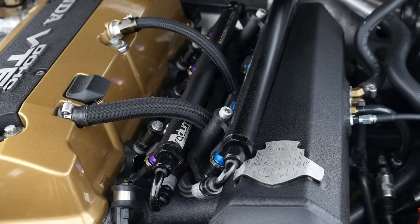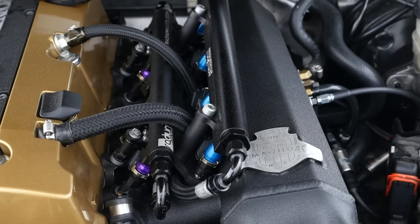It's using Ignite Red, which is like an E90 blend with probably some race gas. The fuel pump is the Veyron fuel pump — the brushless pump that Walbro makes — with a rudimentary controller and a JMS voltage booster, so it's making quite a bit of power out of a single pump. We'll definitely be getting one of the Injector Dynamics fuel pump controllers soon. As far as injectors go, it's got Injector Dynamics 1000cc primaries and 1700cc secondaries. Worth mentioning that Stuart works for T1 Race Development as an Injector Dynamics development and retail outlet, so the ID brand naturally makes an appearance.